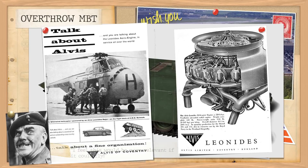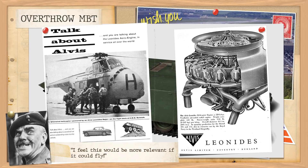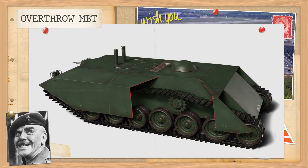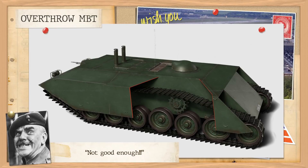Oddly, they also listed that the engine runs at 750 horsepower at 5,500 feet of altitude. The next issue was the tracks. In order to maintain the required 13 PSI ground pressure ratio, they went with 26-inch tracks. But in the conventional layout, these were not long enough to give the best ratio, and due to the vehicle's rear armour there was no way to put a sprocket at the back end. With the internal layout, it couldn't go at the front either. And so, having already thrown most common sense into the bin, they decided to place the drive sprocket in the middle upper centre, in place of one return roller. The rest of the suspension consisted of seven normal road wheels and a forward high idler, with a torsion bar type suspension separated between two half-inch steel plates for mine protection.